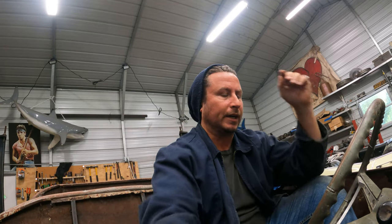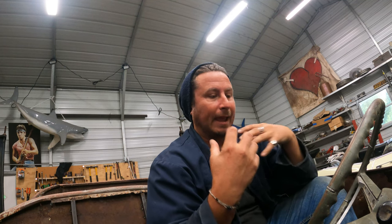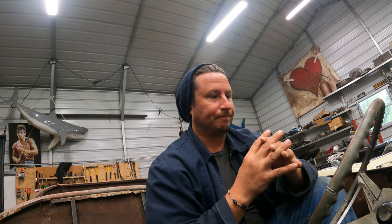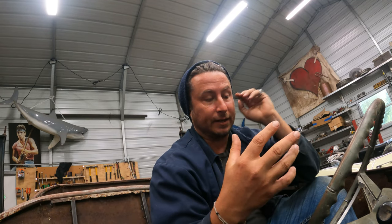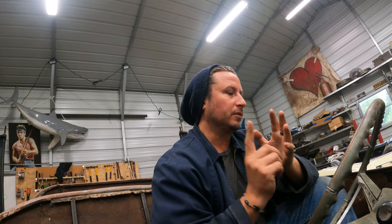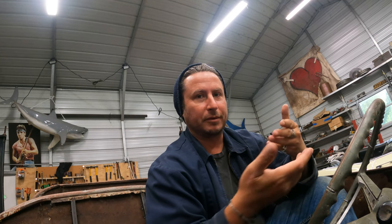This area can be one of the most challenging parts of a hot rod, and a place where you can spend way, way more money than you want to by buying the wrong parts. Wrong parts meaning totally functioning parts that just don't fit together, because everything shares space here and they just have to jive with really, really tight tolerances. So you want to be able to get as much of this together as you can before you continue spending money on steering U joints, or, you know, even mocking up a steering column with a cardboard tube to figure out the length or whatever.